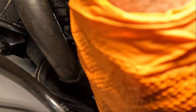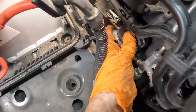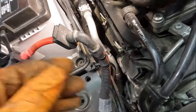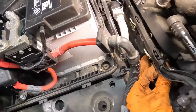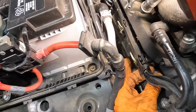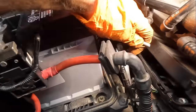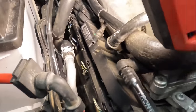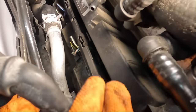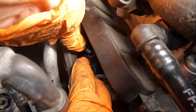I can't see and it's so far away I can barely feel it — I just kind of have to peck at it till I feel it go in. I think that's it. Let's push it in some and see if we can't find the bottom. The connectors face towards the rear — that's why it's not going in. Reach up and around here, pull it out some, rotate it. While I've got my hand right here I'm just going to go ahead and slip that connector on and snap that thing into place — it'll be easier now that I've got some working room. That coil's in, felt it bottom out. Coil number three — slide that down past the cooling hose and move it rearward.